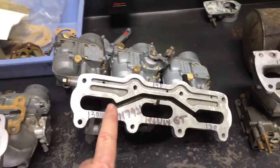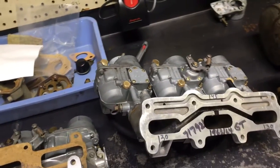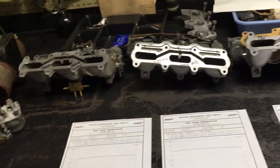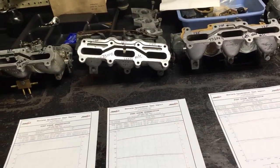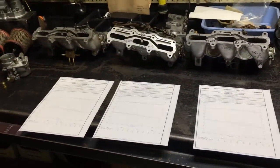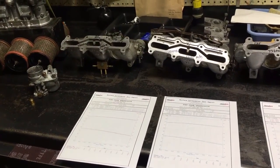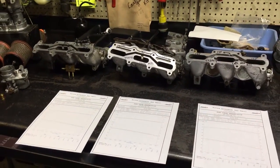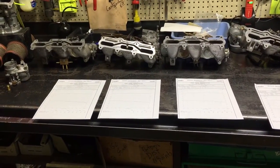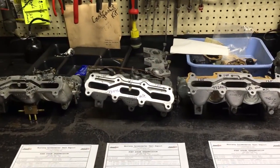Your GTs are a BIC carburetor, a 34 BIC, so they are a little bit different. But they also have the shortest manifold. And manifolds are going to determine what your power band is, and whether you're going to have power on higher RPMs, lower RPMs, that sort of thing. All that has to be taken into account, just as an expansion chamber does when you're racing and doing that sort of thing. But for strictly top-end performance, typically shorter's better.